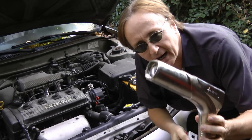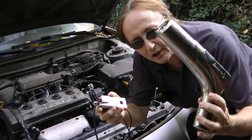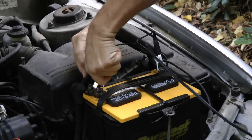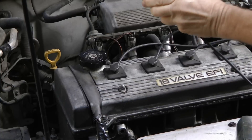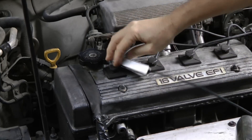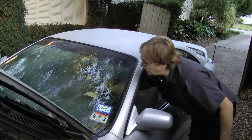So instead of taking the engine apart, you can use a timing gun. They're really easy to hook up — you just connect it to the car's battery, negative to negative and positive to positive. Then get the inductive sensor, put it over the number one spark plug wire near where the spark plug is, and start the car.